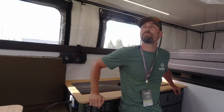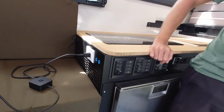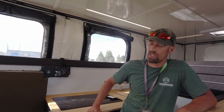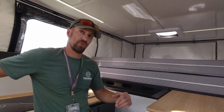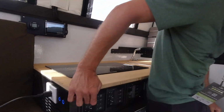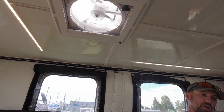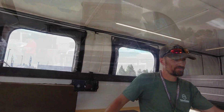We were just talking about how blue light can be disturbing at night when you're trying to sleep. The human mind keeps you alert and awake versus allowing relaxation. So one of the things we did in here is ran all of the additional lighting off the outdoor light circuit. At night, you still have your lights working, but if I kill our interior cabin lights, it pulls all of the blue backlight out of the entire cabin. You can still turn your lights on and off, but there's no backlight anywhere in the cabin. We can make it completely dark for sleeping. It works out pretty well.